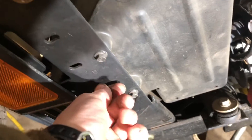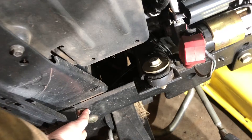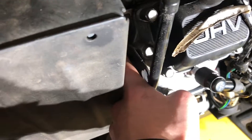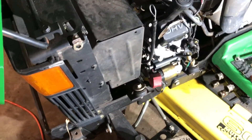What you're going to want to do is - I'm pretty sure you have to unplug the lights if I remember. Push that pin out and then you got to sneak them out. So you can take this off - take these off on each side, there's two on each side. I believe they're an 18 or 19 millimeter. And then you got to be careful with your hood. Buck the grill off so you can get to everything. For the exhaust, two bolts on each side - I'm pretty sure those were 10 mil.